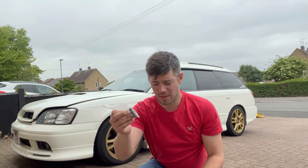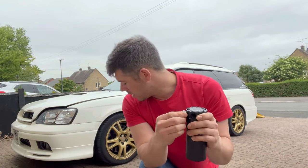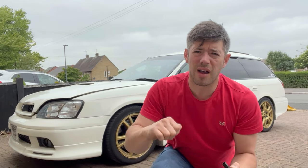I have bought a new PCV valve. I haven't checked the old one — it might have been working perfectly fine — but these are nine quid for a brand new Subaru part, so I'll just fit that. It rattles — nice. On the ports, the Mishimoto comes with these fittings, which are quite nice; you just thread them on. There's no need to go AN fittings or anything like that on a breather system. I know they look good, but you don't need to. These are 12mm internal diameter, so I've got myself 12mm fuel line. Only reason being is because it handles oil, fuel vapour, and a bit of heat. You don't need any clips either because it's only a very, very low pressure system — and that is tight on there.